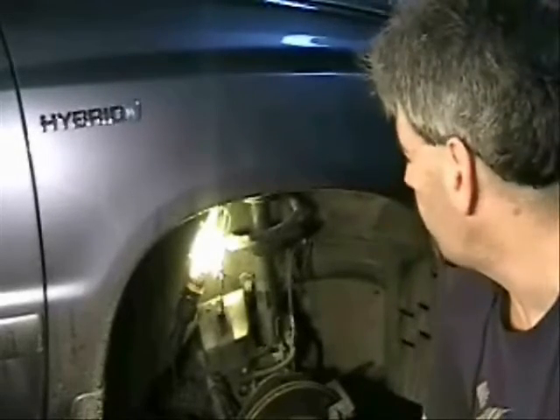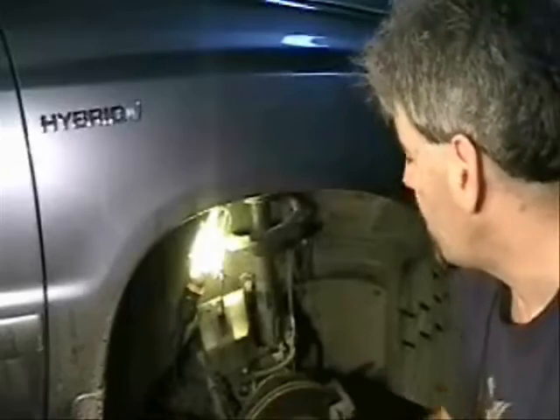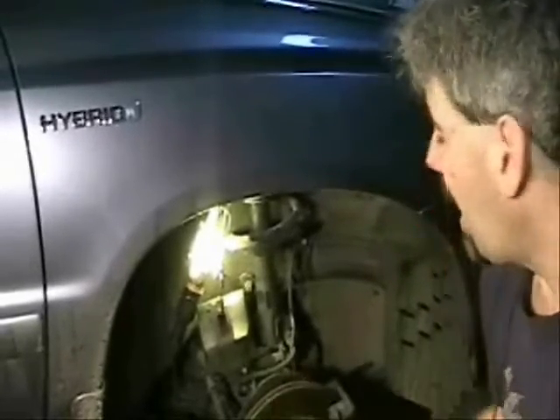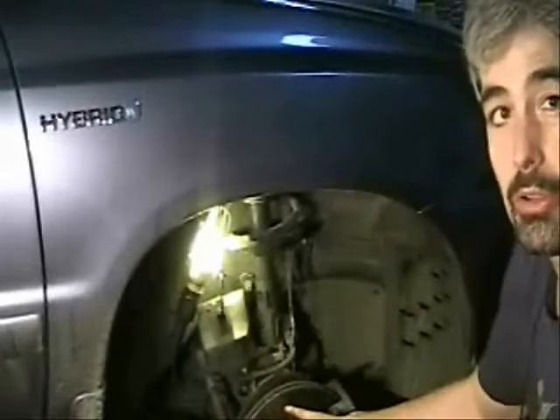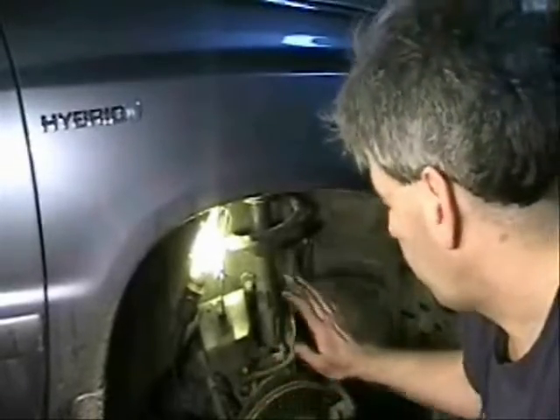At a brake place they'll charge you a couple hundred bucks — they introduce you with the $99 special, but you know how it goes. Every time they redo your brakes, they always turn or resurface the rotors. That's not a bad idea — it ensures a smooth, even braking surface and no pedal pulsation. One problem I have with that is if you redo the rotors every time even when they don't need it, you need new rotors sooner. For me, if there are no deep gouges and the rotors look really good, I measure the run-out. If it's more than a thousandth of an inch, I'll go ahead and cut them. If it's less than that, cutting the rotors won't make a noticeable difference.